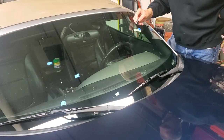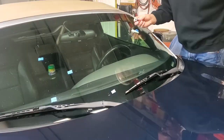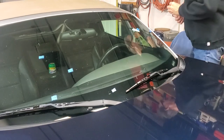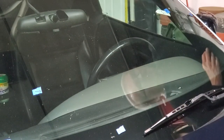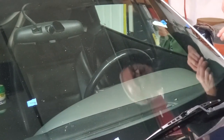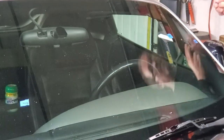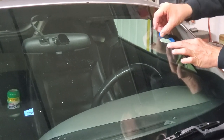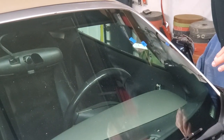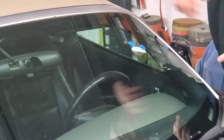We have our little applicator here. We're supposed to work from bottom to top — do a little squeeze and see if anything comes out. Here we have the tip cut off the applicator. We go from bottom to top and see if our stuff will soak in. Then we're supposed to take a little piece of plastic, which they provide, and put it on top. Now I'm not immediately impressed by what that crack looks like, but we're going to see if the repair actually works. I'm going to tape the plastic down. At this point, you have to take it outside and put it in the sun for 10 to 30 minutes, so we're going to set it in full sun and show you the results.